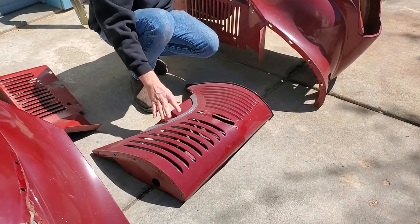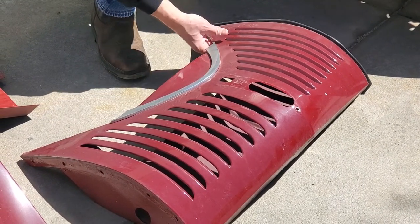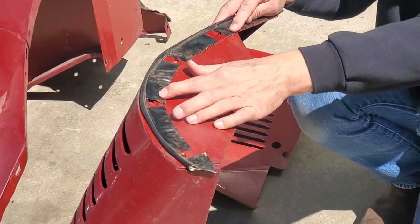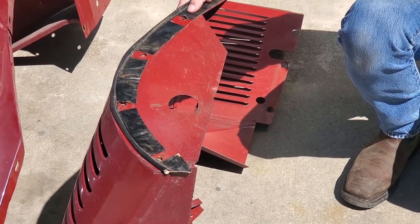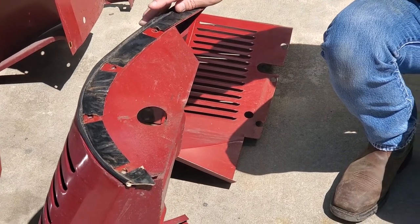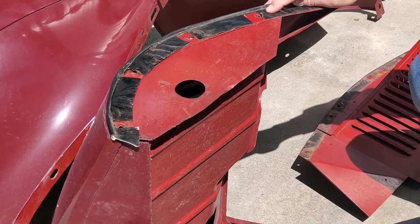This part is known by Graham as the radiator shield. We'll be using it - it's in beautiful shape. We won't be using this trim though; the owner has ordered a brand new reproduction because this one is cracked. Although it could be repaired and plated, the brand new one will probably cost less. What I really want to show is how this person installed the fender welting - completely incorrectly. You'll notice at each place there's a bolt they just cut the fender welting out and squeezed the rest together. That's not the right way to do it.